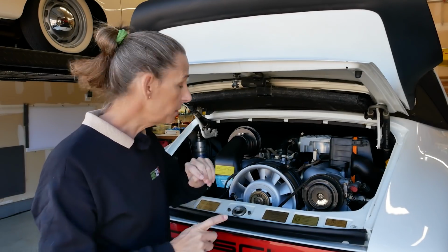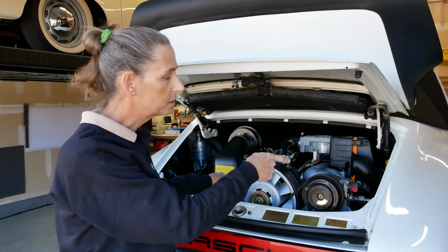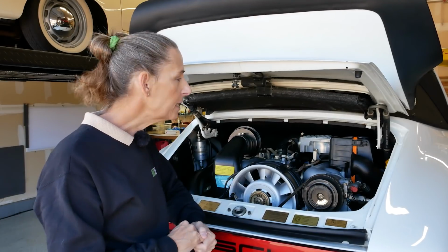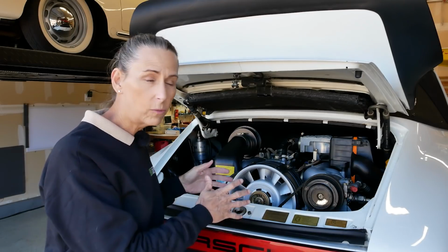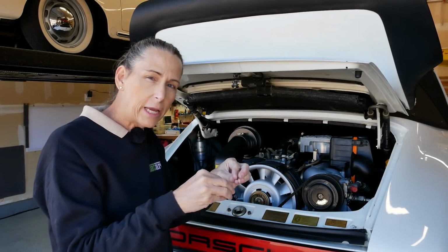It could possibly be a spark plug wire, because that's specific to the actual cylinder, but not our rotor. So I think you're kind of getting the idea. Anything that's general, that will affect all the cylinders, is not something we're really going to start with. We're going to go directly to that one problem, go all the way in, and check it out.